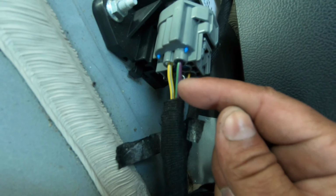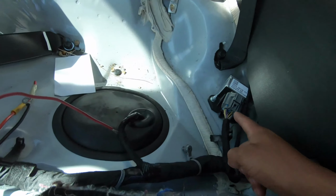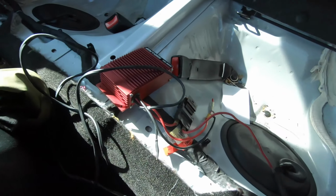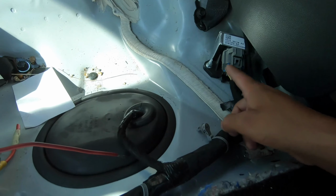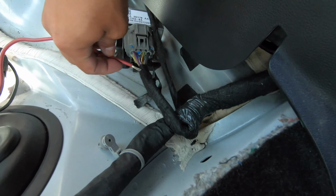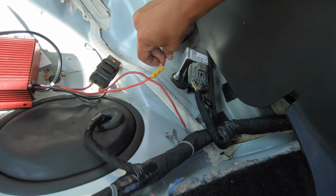So the wire that you're going to want to splice into is the purple with the green stripe, which is right here, this one. You don't want to splice into this wire right here. You don't need it for your booster pump. And here go the 2 positives, which are what you're going to be splicing into. So this is going to be acting kind of like a 3-way. Instead of this feeding directly into here, you're going to cut this, and one wire is going to feed into here, and the other one is going to be returning current into the control module. The wire with the fuse, which is of course this one, here goes the big old fuse, which is like a 40. This right here hooks up into the harness that's going towards the engine. Think of it like a river, technically this is heading downstream. So this wire right here is going to connect to this side over here, while the other wire that does not have the fuse is going to be the wire that runs back into the control module. To give you an idea, the fuse runs this way, and then the non-fuse runs back into the plug itself.